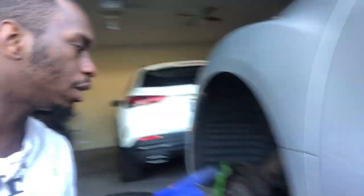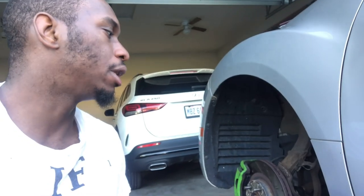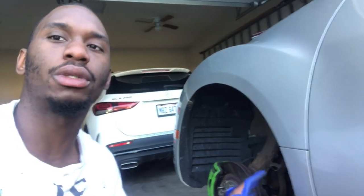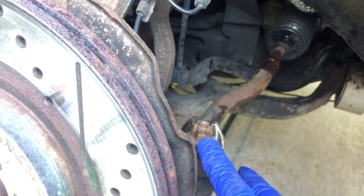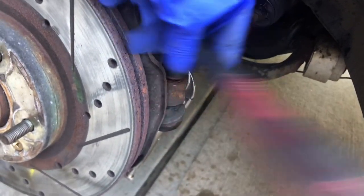Now, because we're not getting an alignment, it's mission critical that you leave the layout exactly how it is right now. So I cracked it back just enough to get it off of the tie rod end, because when we put a new one on, we need the new tie rod end to lock in exactly how this one is. It's broken free right here but it's not backed off that much. So next we're just going to take this jam nut off — the crown — and this is probably a 17. You're going to ratchet it off. Nothing too hectic.